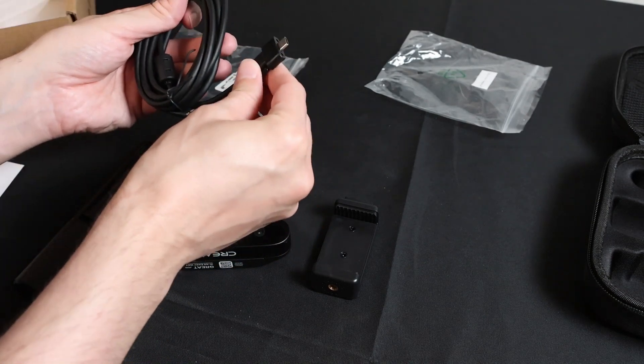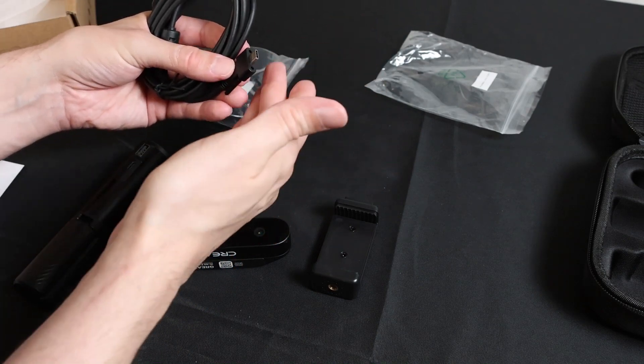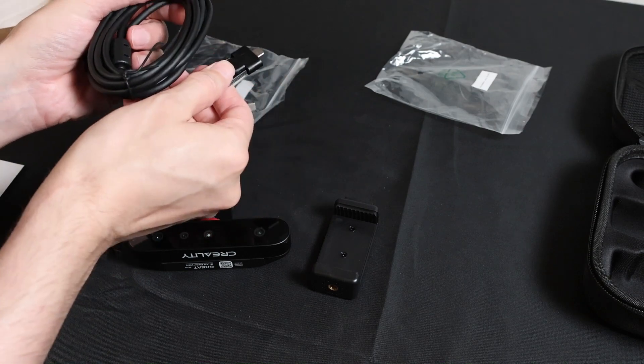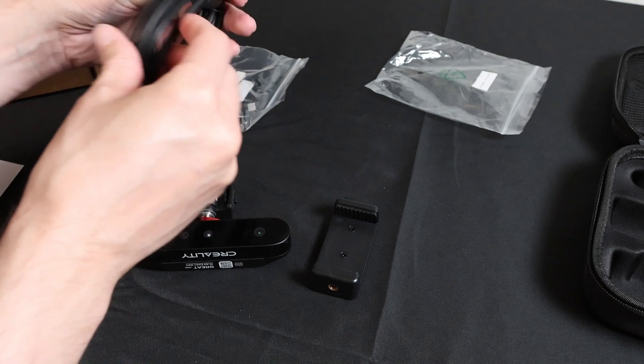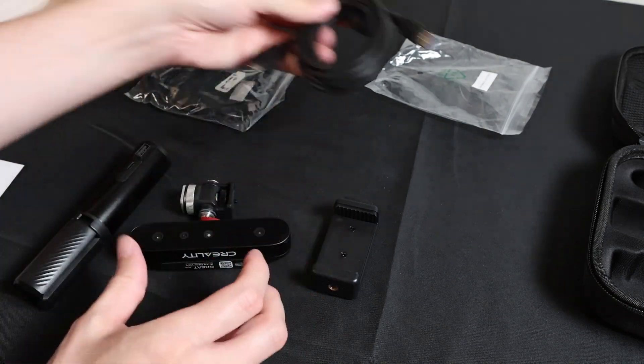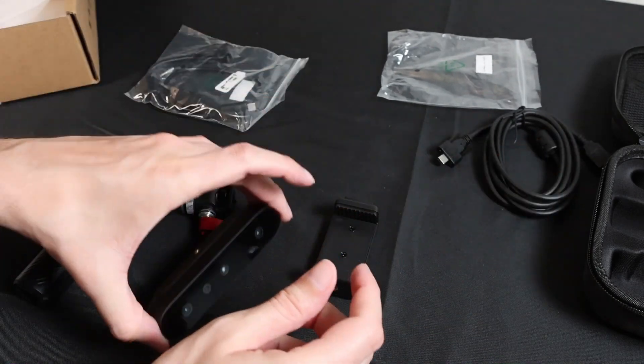Make sure you're using a USB 3 port on your computer — even the instructions say so. Don't plug this in slowly. If you plug it in slowly, it might pick up the first few channels and recognize it as USB 2.0. So make sure you plug it in quickly so it recognizes USB 3.0 on your computer. This is your computer cord that you can take from the scanner right to your computer and just use that.